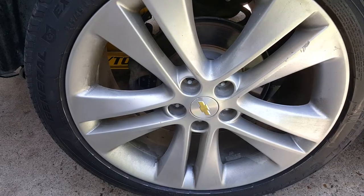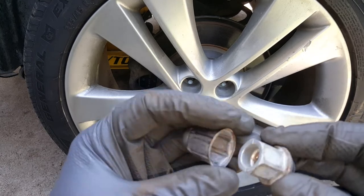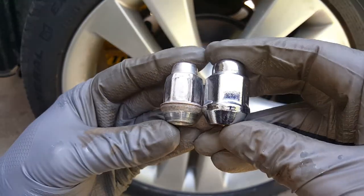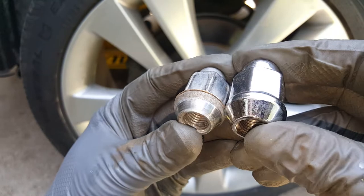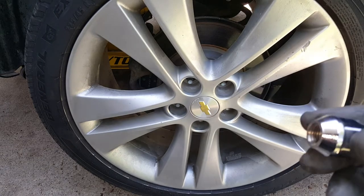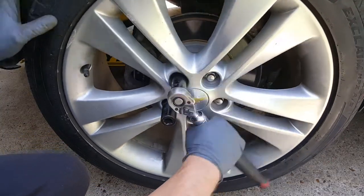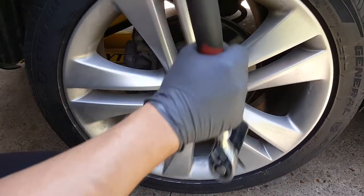So we're ready to go ahead and get the wheel back on. And you remember the pesky — I really dislike these, to say the least. This is the difference between a capped and a forged nut. See, they're identical except this one is a complete forged, so that's the difference. Maybe the angle isn't perfect but it's pretty darn close. So we're going to be putting this forged one back on because I can't stand these capped nuts. The rest of them are working okay. I need to find a set of these and leave a link. Now the only drawback is I now have a 21mm nut and the rest of these being 19s, but I usually keep a four-way anyway — it has all the sizes.